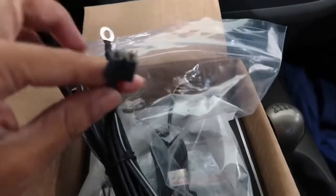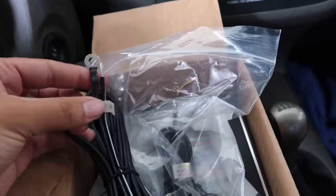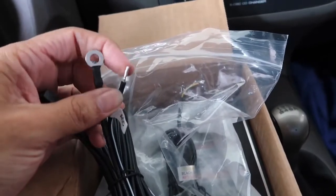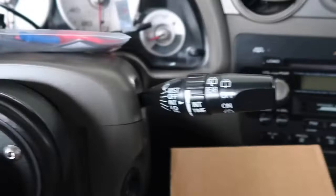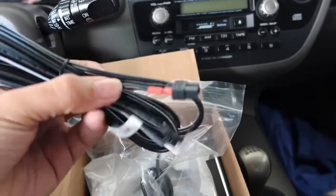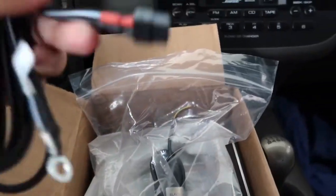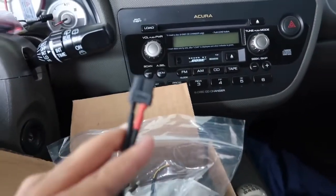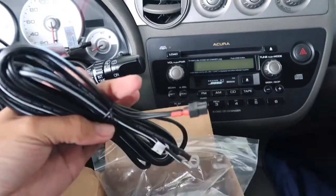So this is the hard wiring kit right here. You basically plug this into your battery — this goes into ground and this is your accessory — and this would go into one of those butt connectors into the fuse box. They give you an assortment of which fuse tap you need. This will be run to under the seat, under the dash, or wherever. And this connector is an XT60 — basically like an RC car LiPo pack plug, just smaller.